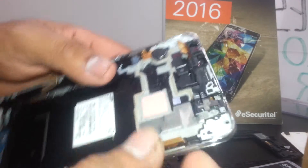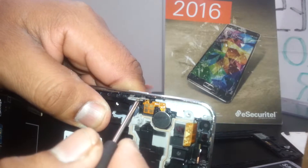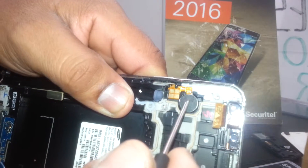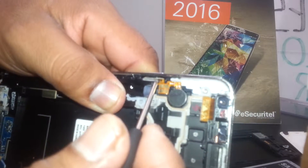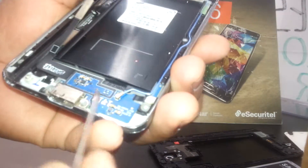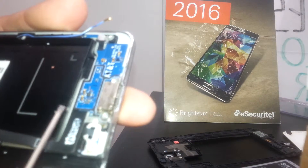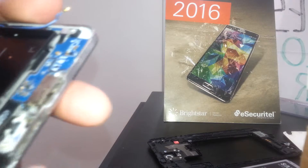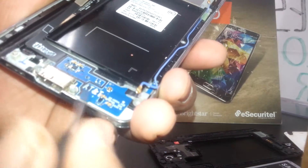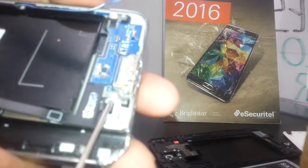You can easily remove it as well — just pop it up. Be very careful; insert the flat-end screwdriver under the frame and lift it. I won't do it here because it's not the issue we're addressing. Now we get to the main reason we disassembled this phone: to change the charging port. To remove the charging port, we're going to insert the flat-end screwdriver and lift this panel.